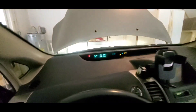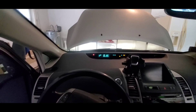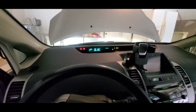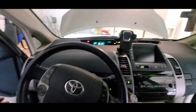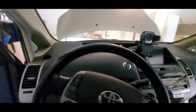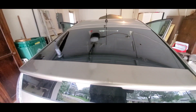You can hear the car shut off, but that is just the gas engine — the hybrid should still be running. So we'll remove this and then jump in and hit the gas pedal and see if we are still running. We don't hear it running so we're afraid it shut back off. Hit the gas pedal — you can hear the gas engine come back on. What you want to do is drive this car around and slowly brake so it'll charge back up, but you also want to get your battery replaced — not the hybrid battery.